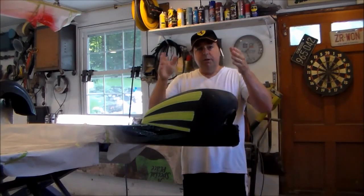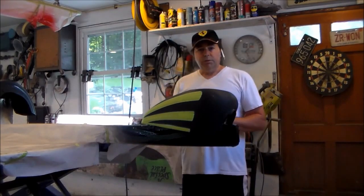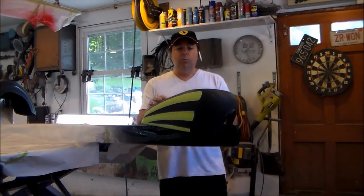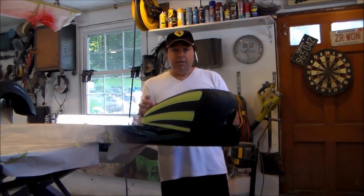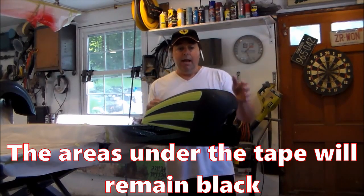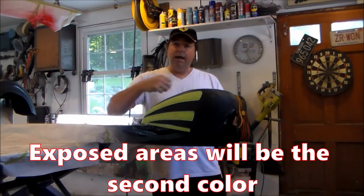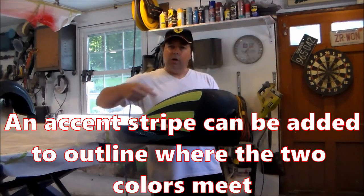It's more or less just straight points — you can tape them and angle them any way you want. I've got this set of tins and I've laid out my scallops. I've put the fine line down and also put some masking tape down so you can see what I have. Everything underneath the masking tape is the black base coat I already laid down. Everything you can see right now is going to be my secondary color, which is red.